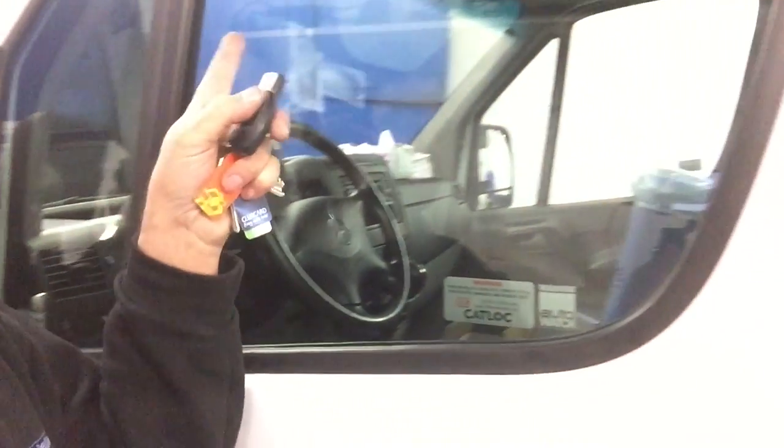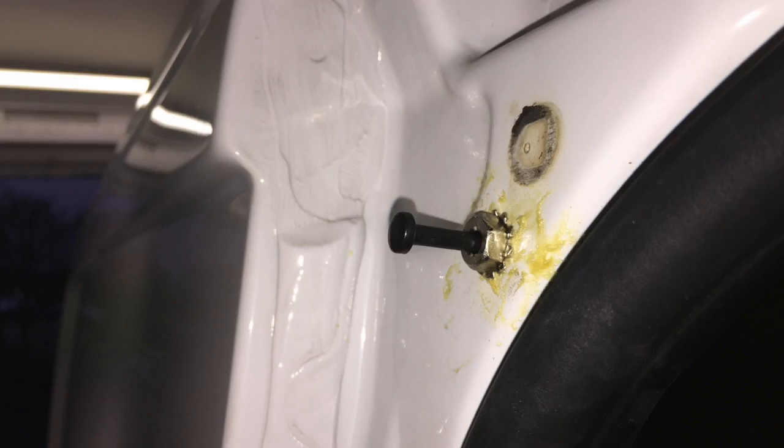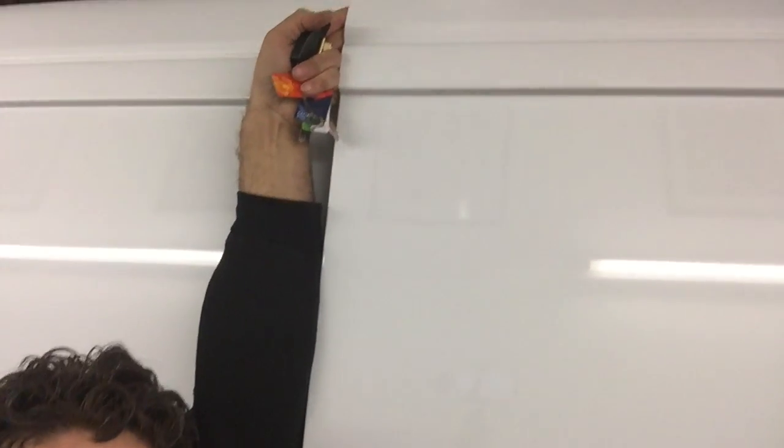We fitted ultrasonic sensors in the cab which go up on the top of the pillars, and the doors already have switches on them. But we've done a little bit more than just that. On the load area — if you just come around with me here — on this side load door, we fit an extra switch right up in the top corner. That switch protects against anyone trying to fold the side load door over; it will trigger the alarm early, hopefully before they damage the door or progress further.